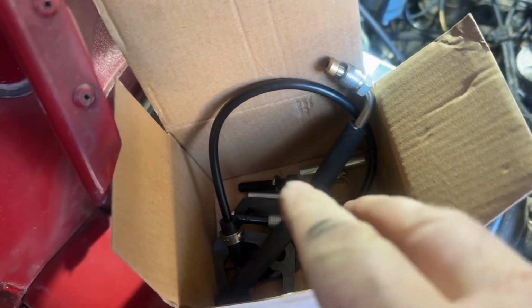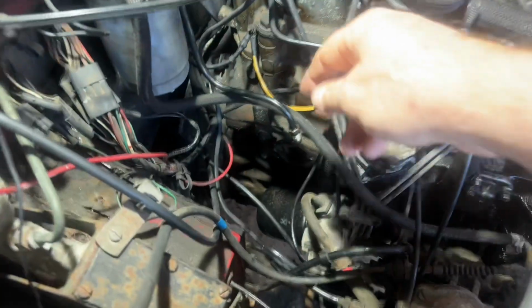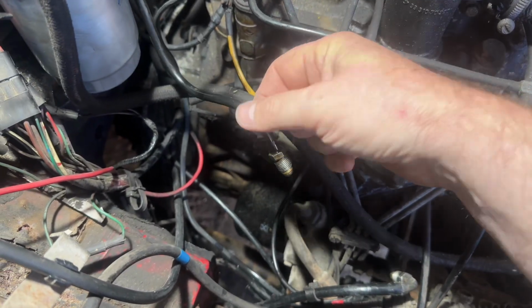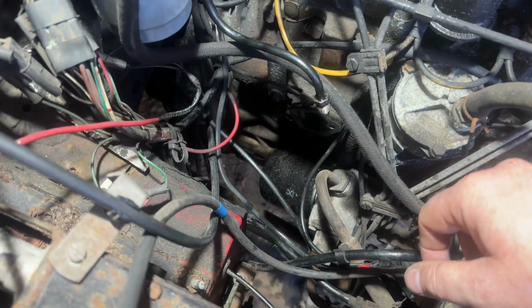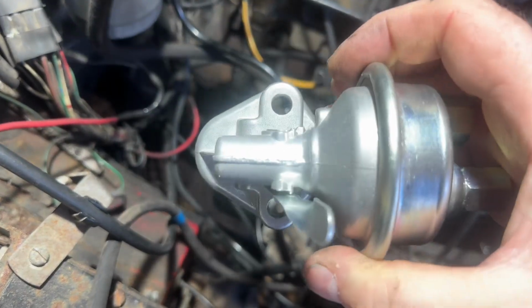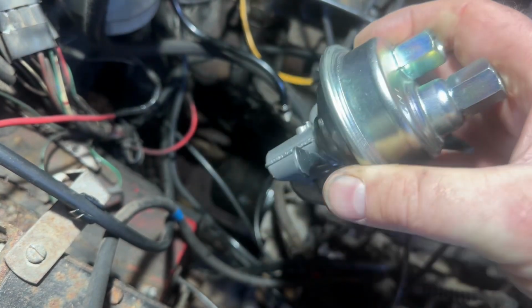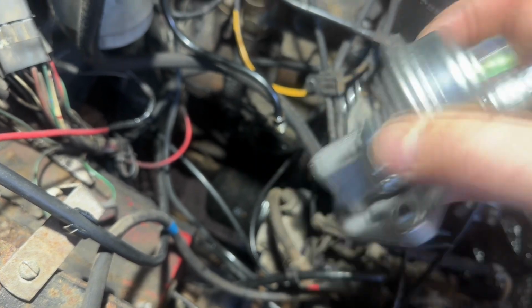Although they have given us brand new pipes and everything, I think I'm going to leave these ones on. There's nothing wrong with these. And I think just by pulling them off, it could introduce a leak. So I'm going to leave those on and just screw on the new part. Basically, two little cap bolts through the holes, holding that on, and put the two fuel pipes back on, and then hopefully we can prime it back up again. So let's see if it is actually that easy.